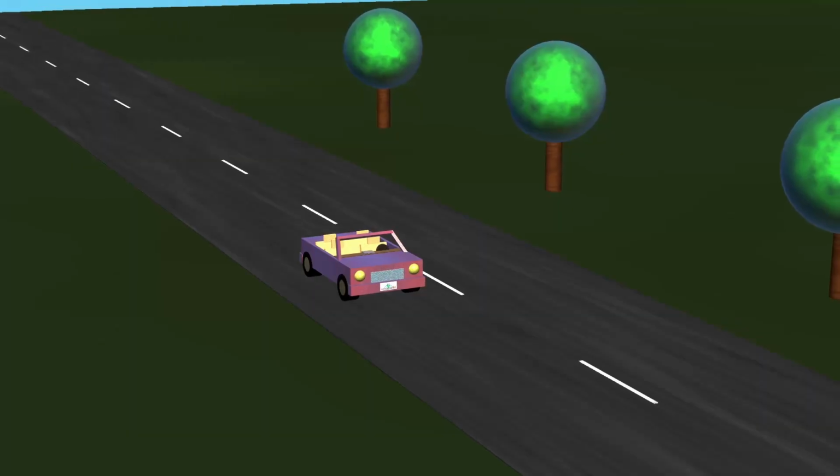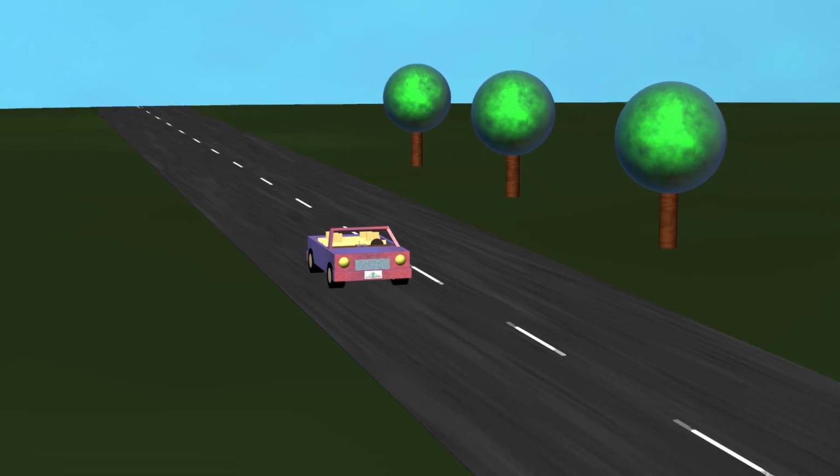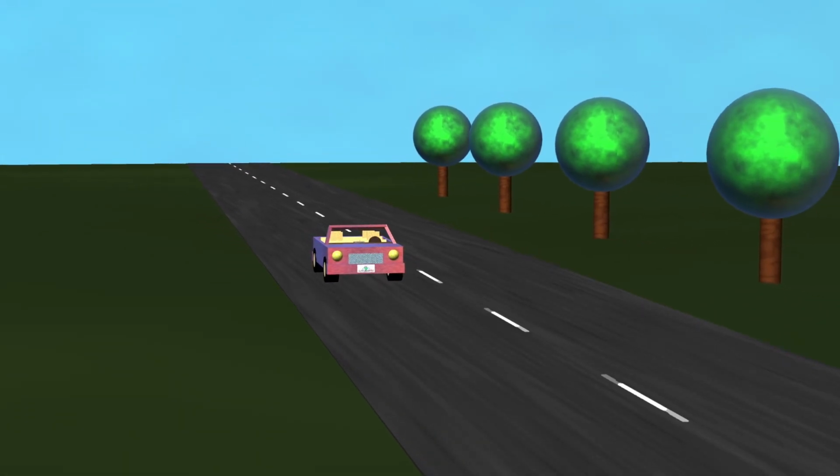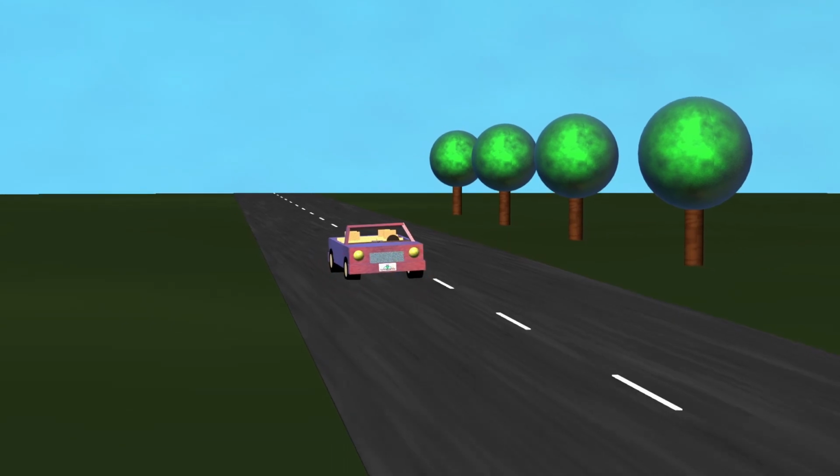I made this animation to hopefully explain it a little better, how to distinguish what bearing the noise is coming from. Let's say it is the driver's side wheel bearing that is worn, which it is on this Jetta. You see how the vehicle is leaning toward the right side and the left side goes up? That means all the weight is on the passenger side and no weight is on the worn bearing.